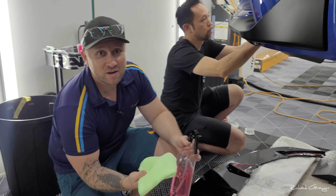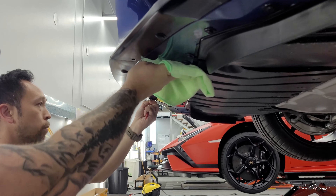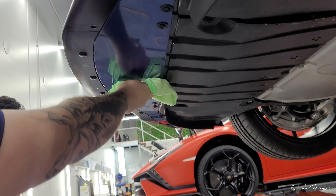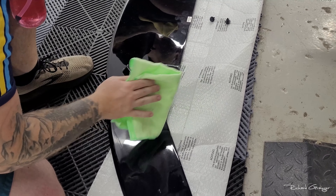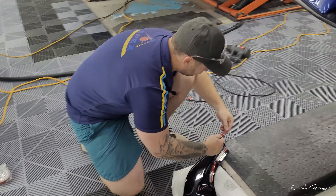I've got some wax and grease remover. We're going to use quite a bit of double-sided tape on this so I'll go ahead and wipe all under here, especially this spot just here where it makes that little triangle. I'll also wipe down the actual spoiler itself to make sure it sticks nicely. There's quite a bit of double-sided tape in the package and I'm going to put it just in here.